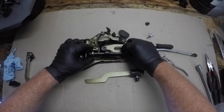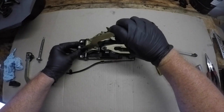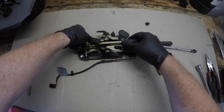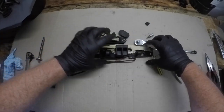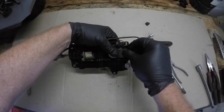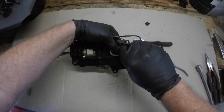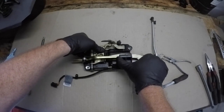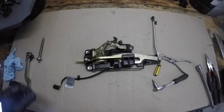It's now time to install the new part into the latching mechanism. Take the threaded rod and move it right out of the way. Sometimes it's a little bit easier just to press the latch down while you slide this component in — and that will fit in quite nicely, with that metal collar slipping through and sitting into there. The piece that we removed will sit over the top. At this stage I just did it up firm but certainly didn't tighten it fully with the ratchet, because when reassembling parts like this I like to wait until the end to make sure I've got things right before tightening everything up. I was just checking that it had a fairly free movement of operation and wasn't binding in any way.